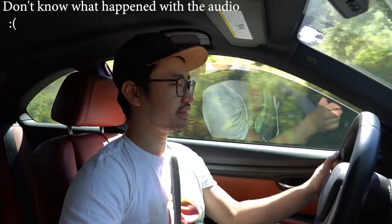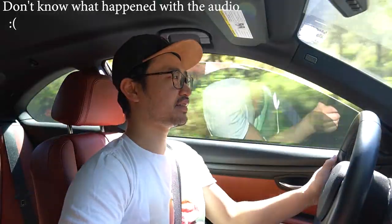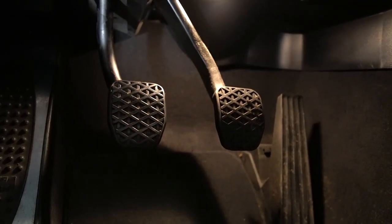If you guys are on the fence about whether to get the Ultimate Clutch Pedal and you have a six-speed manual on your E92, I definitely recommend you get it. Overall the pedal feels a lot firmer and you can adjust the stiffness setting. The feeling is much more linear, the throws are shorter, and the catch point is not so high anymore — it's more towards the middle of the pedal travel. The pedal is also at the same level as the brake pedal, and while it doesn't seem like a big difference, ergonomically it feels very different when you're driving.